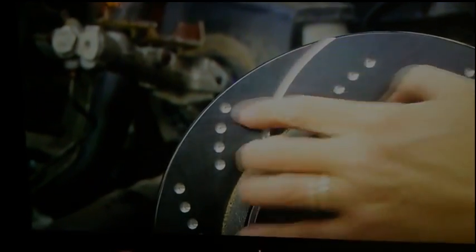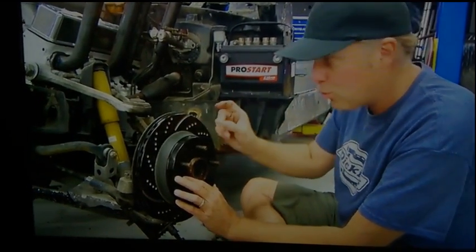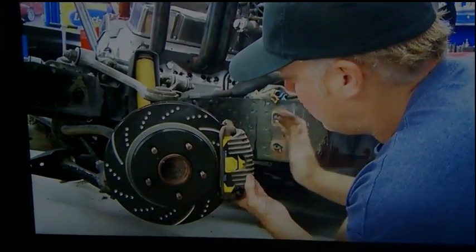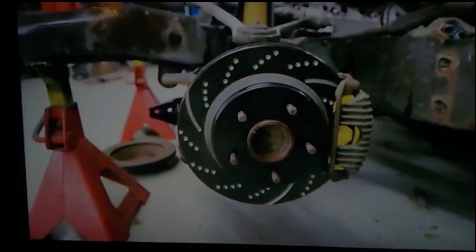They put this slot in here because a lot of the aftermarket rotors that just have the dots cut in them will actually groove the pad. And they're like, this is there to keep the pad face flat. This is the standard operating procedure for Roadkill, putting way too nice of parts on way too junky a car.